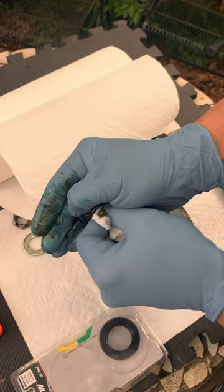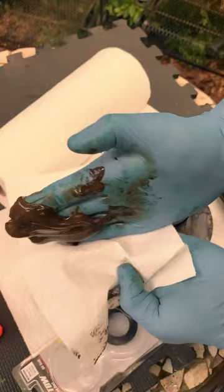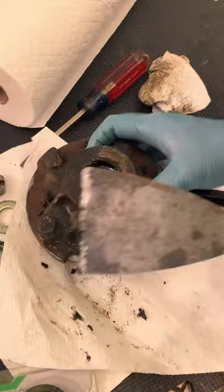Next, clean up that spindle and inspect for damage. They're usually okay because they're tough enough to endure your negligence. Now wipe all the old grease out of the outer bearing and inspect that too. This one's fine, but if it's badly worn or falling apart, you can get a brand new set for 15 bucks. Now go ahead and wipe the bulk of the old grease out of the inner hub and scrape off any caked up dirt off the backside so you can see what you're doing on the next part.